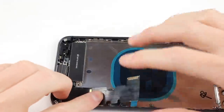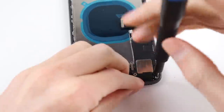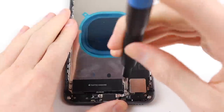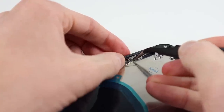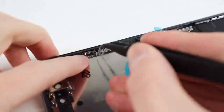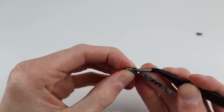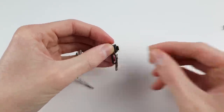With the dock connector and smaller components installed like the Taptic engine, I can remove the plastic film and adhere down the dock connector. I can then install the loudspeaker on top of that and its appropriate screws and antenna cable. There's a few more smaller metal brackets I'll need to install, and I can't forget these little metal clip things that we took off from the old volume and power buttons which I'll need to install on the new ones. This just helps with the clicky feel on the buttons of the iPhone. I'll also be changing across the mute switch with a new one as the old one has some marks in it.